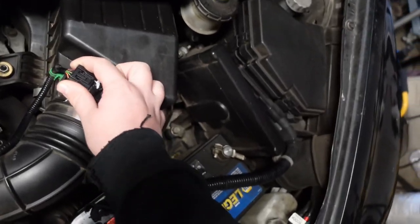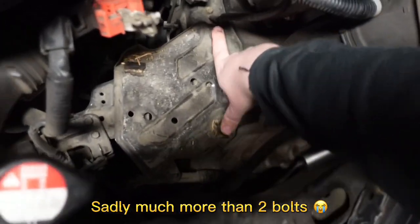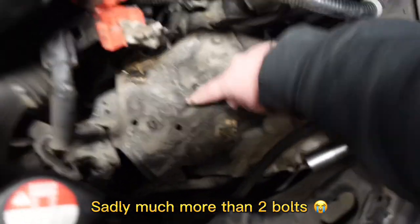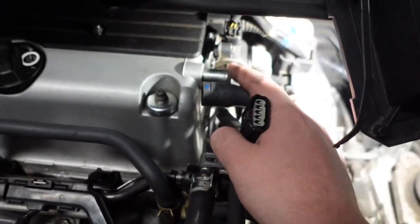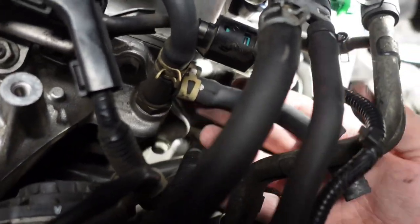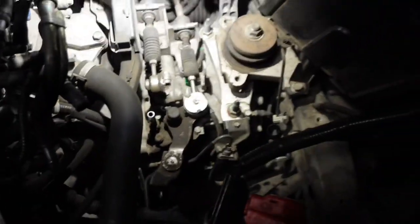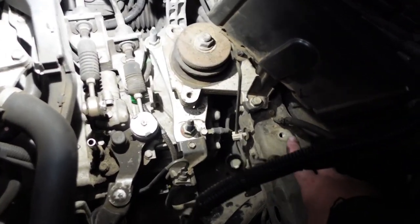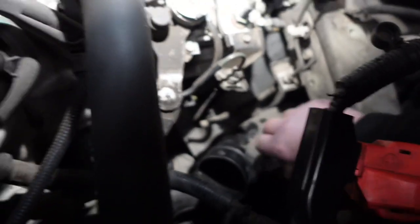Battery out. You want to remove the tray — just two bolts and a clip. Little update: intake is out. These hoses are a little confusing. The big hose on the intake kit goes to your intake and the little one goes to the throttle body for coolant. Battery tray is out. Also, you are going to have to take the tire off to get the rest of the intake piping out because there's a bolt right under the fender liner — so that's frustrating.